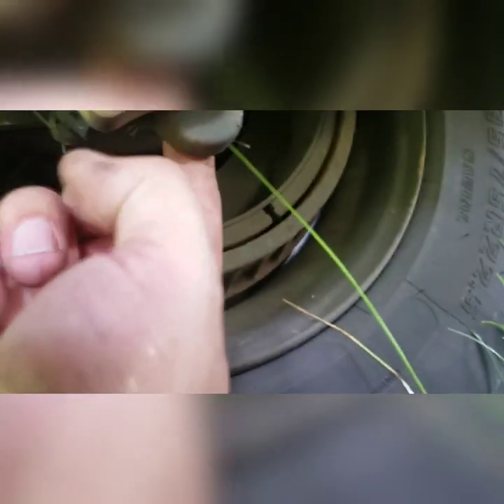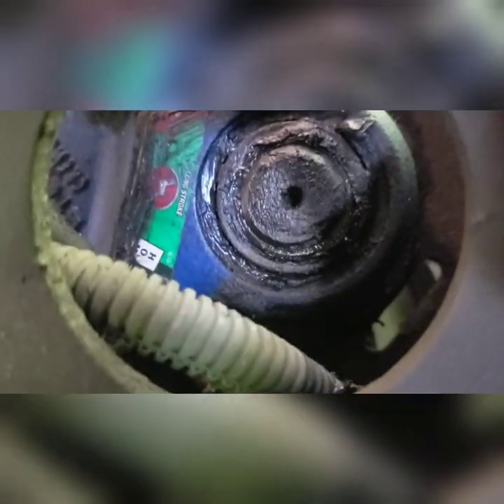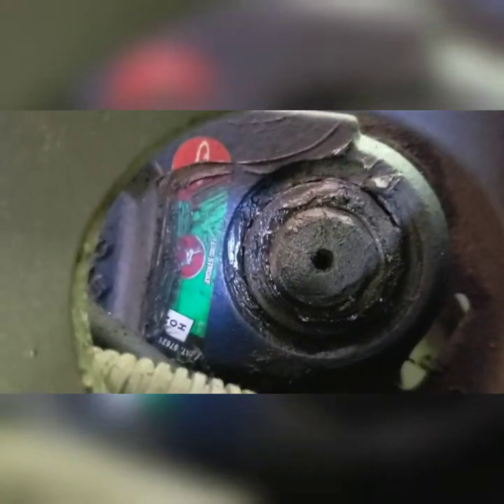This is an automatic slack adjuster, so I'm going to have to take out the cotter pins. There are two cotter pins right here. I'll take out the snap ring from the center so I'm able to take it out. Now I have the pins out and I took out the snap ring, so the slack adjuster is loose. And I have to take out those washers as well.